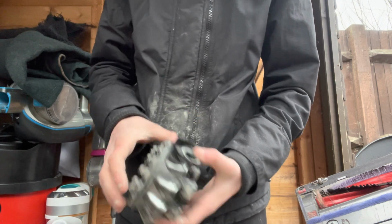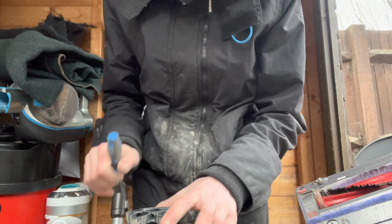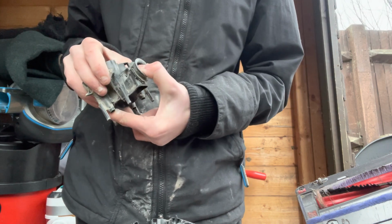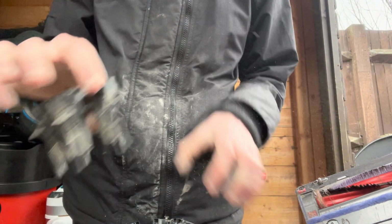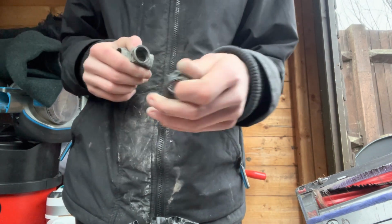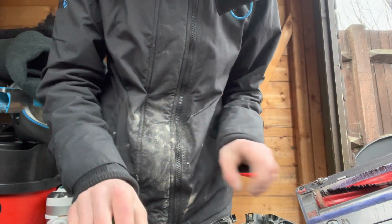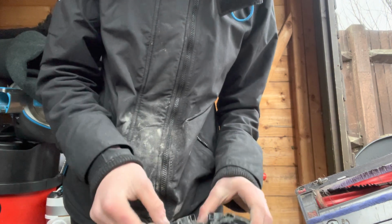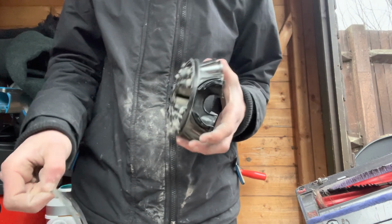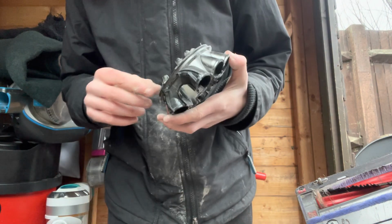And then basically, if you lift that over, you get some screws stuck. Just get your little screwdriver and just pop them out. And then if you've got this bit that comes out together, if you just pull that out, it can be stiff. So you got that piece, and you'll have that piece. If you also want to take the back seal off, which you just pull off, and then that comes in too. Make sure you pick up these screws once they're out, and then you've got your little cyclone. You'll also have a little rubber seal just around here. If you just take that off, make sure you get a majority of this dirt off, just so it's easier to clean.